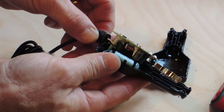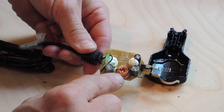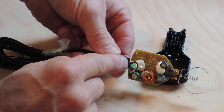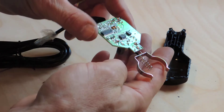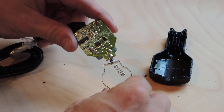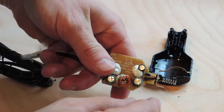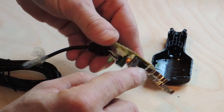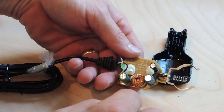There — that separates the two halves and you've got the circuit card inside, which is what the Garmin unit is checking against. I want to be careful I didn't damage those wires while prying. Basically all you need is to identify the negative ground — this part right here — and the spring in the middle which is the positive. I can just desolder those connections and put a wire on the positive and a wire on the negative on the same circuit card. Now I have wires I can connect directly to the bike.